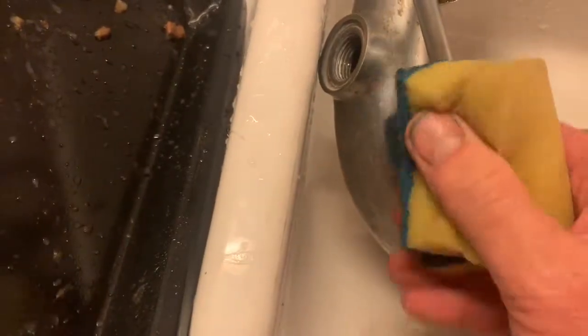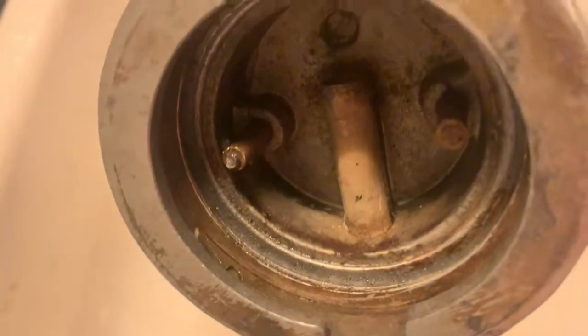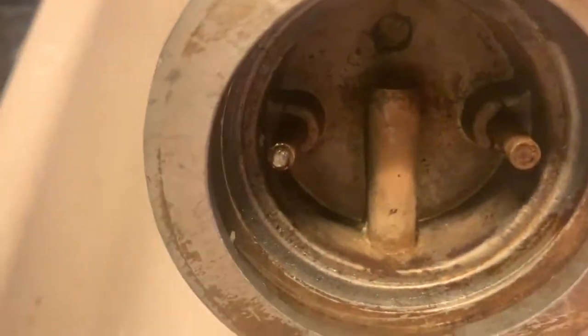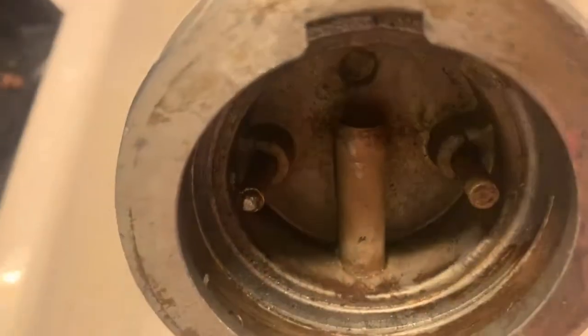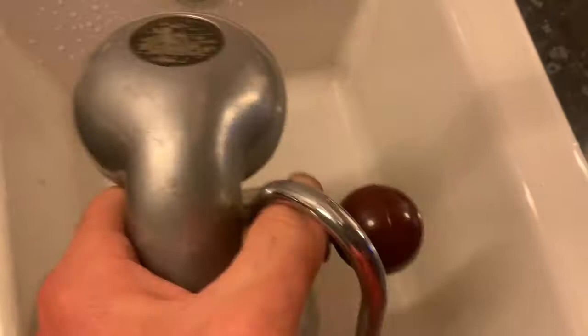Actually, don't bother cleaning the label at all — you risk rubbing it off. Just use the abrasive end of a sponge to wipe the milk steam arm. You don't have to do this — it won't affect the taste of your coffee — but give the machine a rub down every now and again. If you don't clean the plate, it'll taint your coffee and eventually affect the flow. Jess used to put a bit of water in there and give it a good shake around every now and again and empty it out.